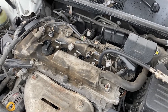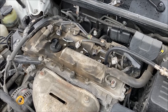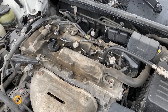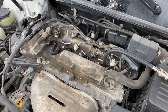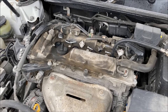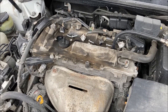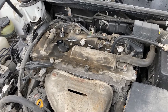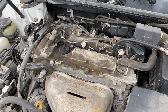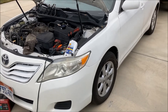This motor would need to be taken out and rebuilt. We'd want to check the head area as well — there still could be an issue on the head gasket or valve side, and we want those inspected when the engine is pulled and torn apart. Another option would be to replace the whole motor, but the price on that is pretty significant. This motor is definitely compromised and we're going to take the engine out and get it remedied. Look forward to a few more videos working that out on this 2011 Camry.